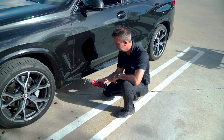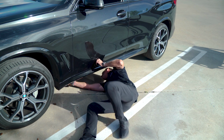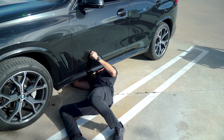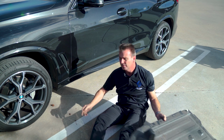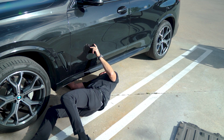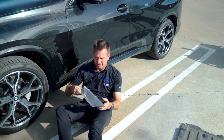I like to use an electric ratchet or screw gun like this, or whatever you have. First, we're going to remove the under panel here attached with between 8 and 16 fasteners, depending on the model. And that comes out like that. And then next, there is on this model a metal heat shield that's held on with 2 10mm fasteners. And that looks like this on this guy.